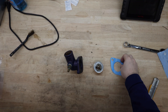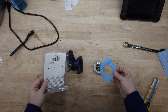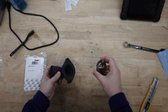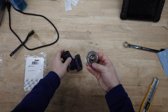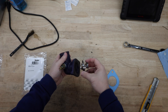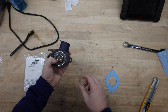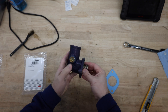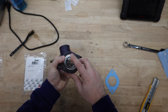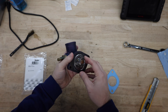To put this together, we have the gasket — it's a Felpro 3504. The gasket is going to go right on here and then the thermostat goes inside. It's important while we put the thermostat in that we get the hole straight up, because we want to make sure any air in there can get through. This side goes towards the outside of the engine, this side sticks into the engine. Let's go ahead and get this on the car.